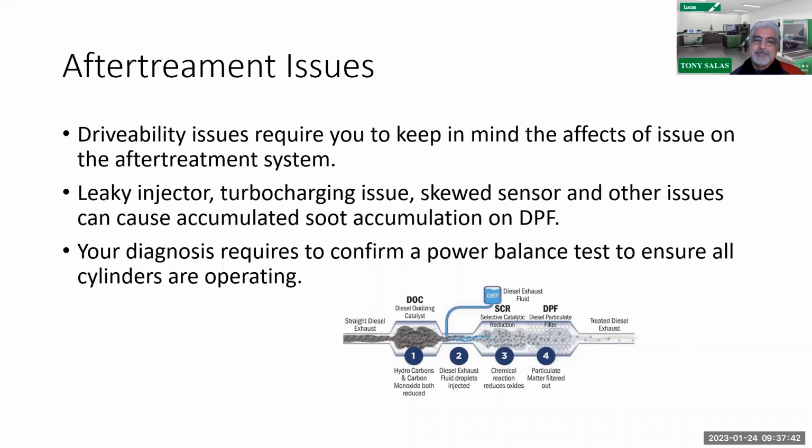and that is how much blow-by or crankcase pressure is coming out of this puppy. Excessive crankcase pressure is becoming the norm, at least in my area and other shops I've talked to. Guys, take a look. Just simply fire up the engine and take that oil cap off, and let's see if this thing has been well maintained. Some of you might get a truck that has 60,000 miles, some 180,000, and now I'm seeing some trucks with over 200,000 miles. So we don't know how well these trucks have been maintained.